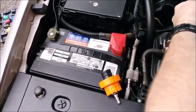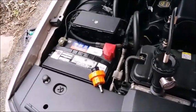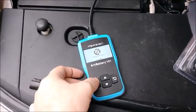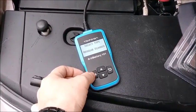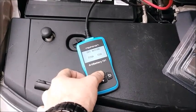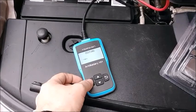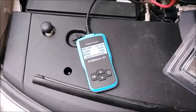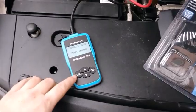It's dated 9 of 19. We'll hook our battery tester up to it, fire her up, and see what state the battery is in. We've got the battery tester hooked up. It says 12.08 volts. It's a regular flooded battery rated at 750 cold cranking amps. State of health is 100%, state of charge is 15%. It's actually putting out 810 amps, rated for 750, but it does need a recharge. Now we'll do the cranking test - start the engine.